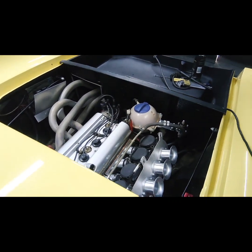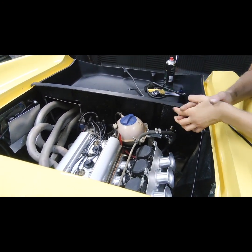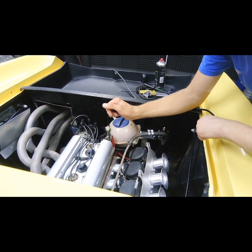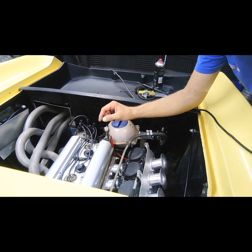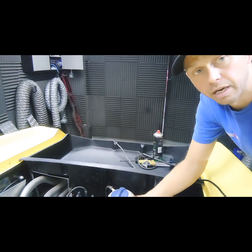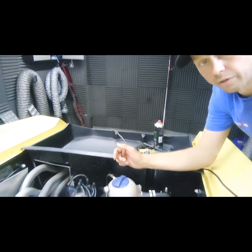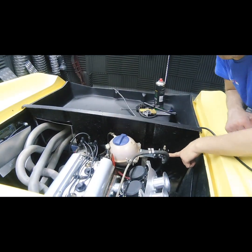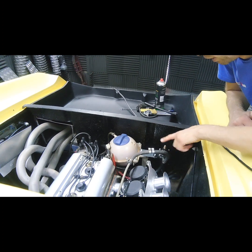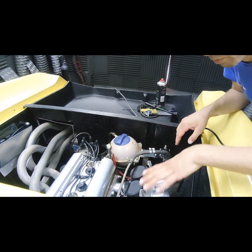It's not the carbs I want to cover today — it's actually the EFI to carbs conversion. The main thing with this is we have 3 bar fuel pressure from the original EFI fuel pump, if not more. On some systems it can be up to 4 bar, 4.5 bar, and we need to get it right down to 3 psi for the carburettors. We do sell this regulator here, which is an EFI to carb regulator — I will link this in the description below — and this is basically designed to bring that massive pressure of 3.5 to 4 bar down to the 3 psi that's needed.